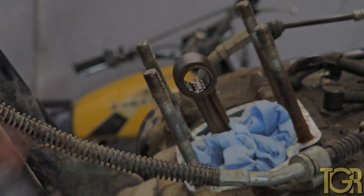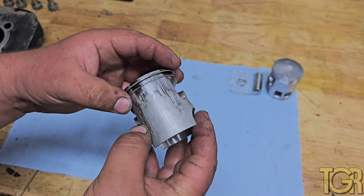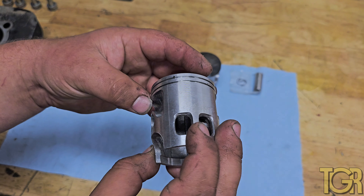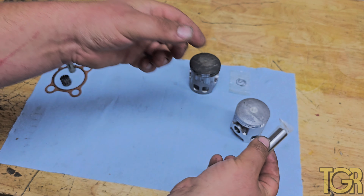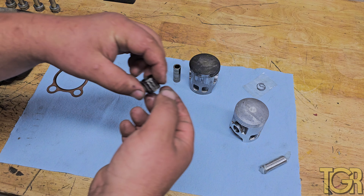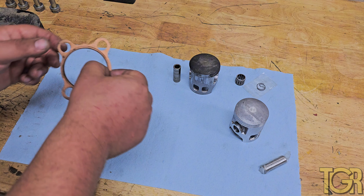Let's get everything out on the table and start cleaning to see what's salvageable. Taking a closer look, you can really see that this thing had insufficient lubrication on the cylinder walls and the piston skirt — that's what welded it up and caused us to lose all compression. Here is a new piston — what it's supposed to look like. It comes with a new wrist pin; here's our old wrist pin, and it's really not that bad, but if we have a new one we're going to use it. It also came with new snap rings. And here is our bearing — we'll clean that up and I'll try to find a new one, because if we've got it apart we may as well.